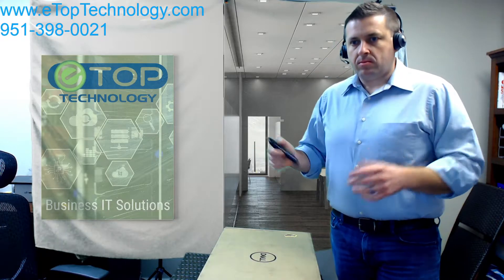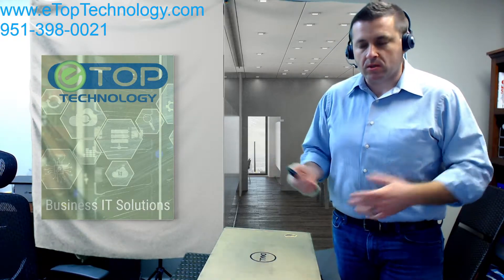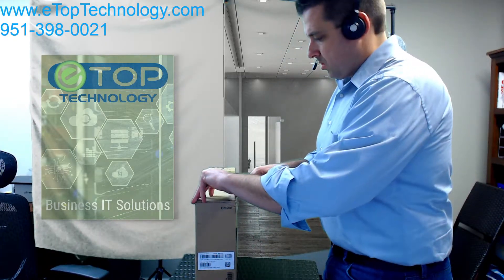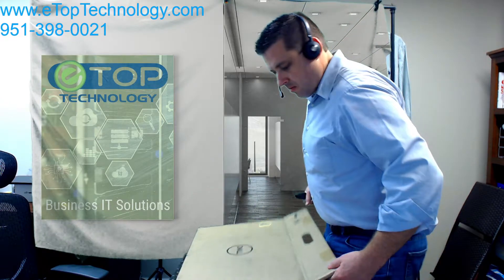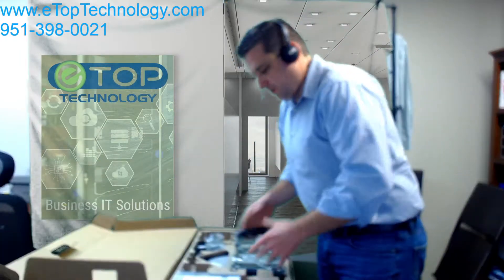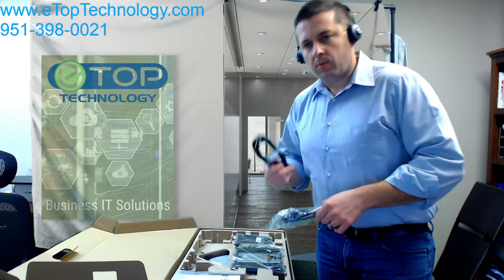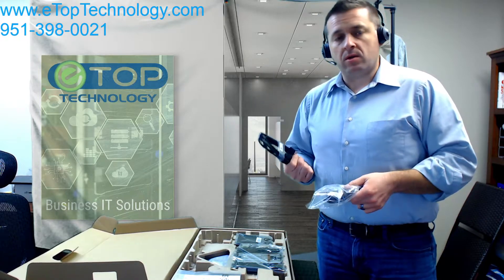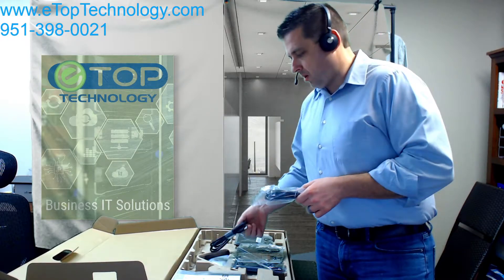So what's going to happen here — you'll probably need some kind of razor blade, knife, or a key works really great. Go right here, flip it up. There should be two pieces of tape on the back. Flip it open. There's going to be a couple of cables — one's power, one's DisplayPort. Make sure to keep both of these. One's to power the monitor, the other connects the DisplayPort on your docking station to the DisplayPort on your monitor.